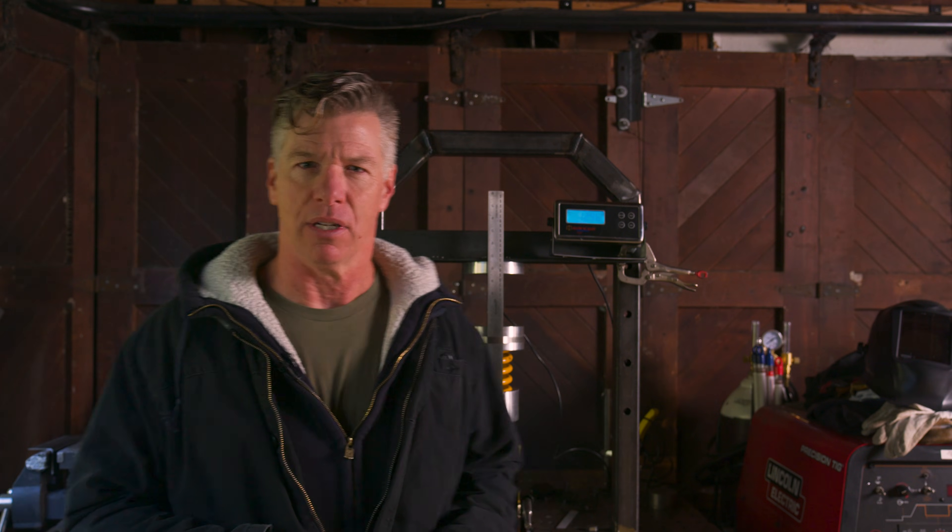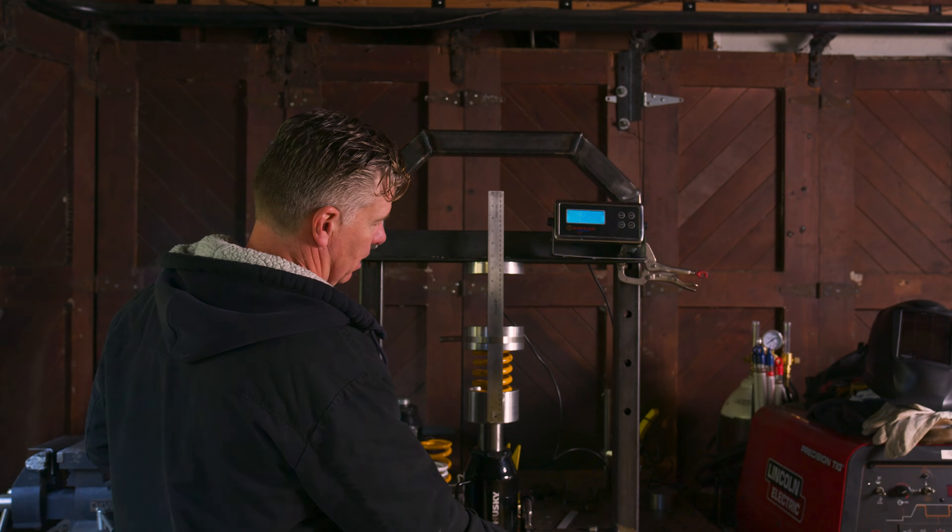What's also very interesting — let me take the pressure off this thing — is that if I generate 1,295 to 1,300 pounds of force when I ride my bike at race pace, Gavin uses a 100 N/mm spring and uses 40 millimeters of travel. So he's generating different force. I wonder how much different force Gavin is generating than I am. I have a 100 spring — let's put it in the jig.